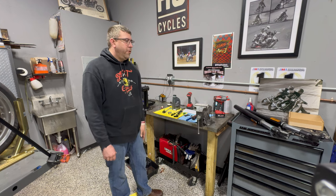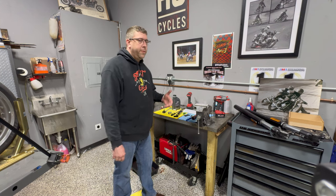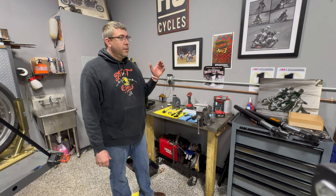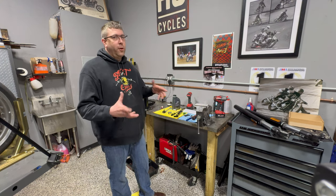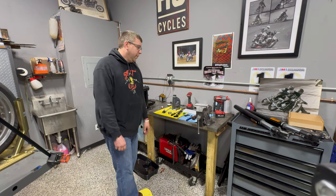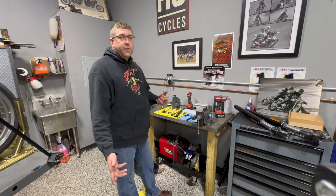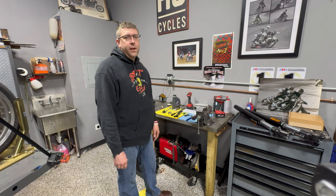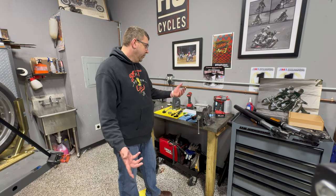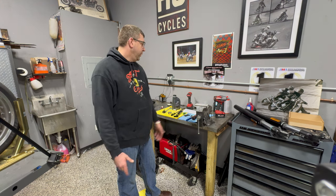In the comments, since I didn't go through actually removing and reinstalling this on the bike, I will list out all the torque specs for reassembly - triple tree upper and lower, axle pinch bolts. I hope you found this informative; it really is one of the easier kits to install. We're selling a lot of the Nitron kit. I recommend the 25mm kit - the 22mm is normally for 41mm forks as a cheaper alternative, but 25mm gives you more control and bigger components. The pro kit just adds DLC coatings on all internal components to make it more frictionless. If you have any questions, hit us up in the comments or on our website. Email is info@ajcyclesny.com. If you like the video, give us a like and follow - more tech videos like this are coming soon.